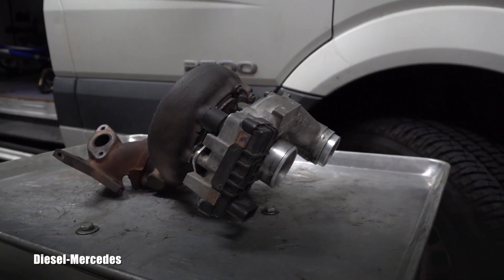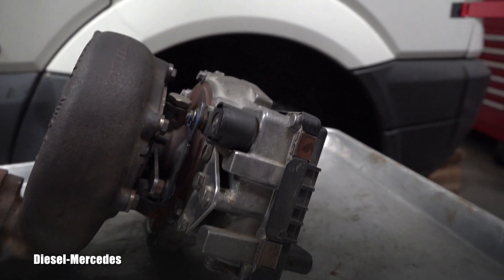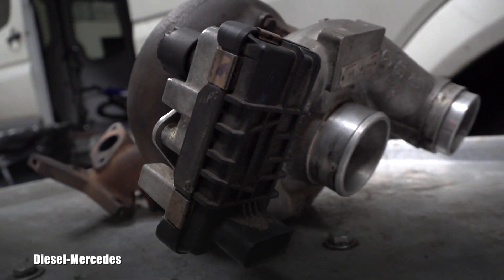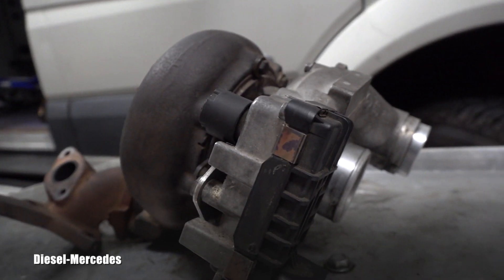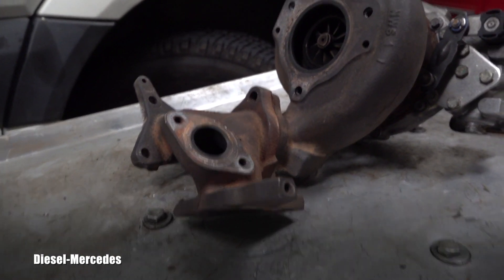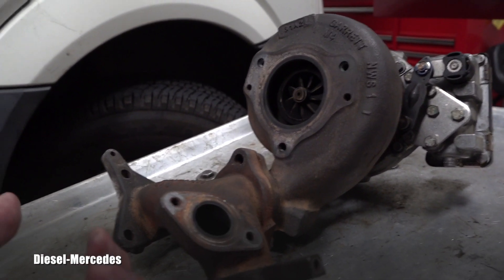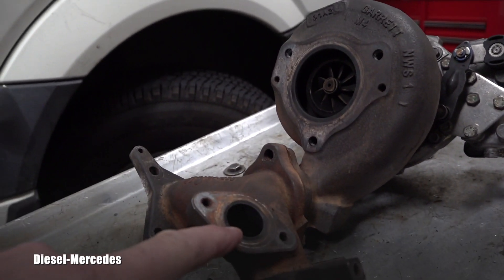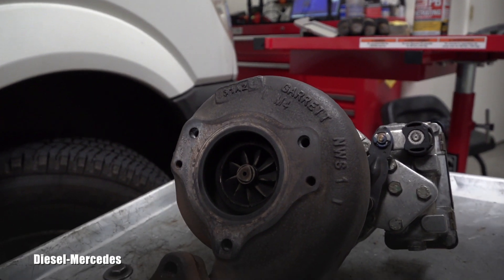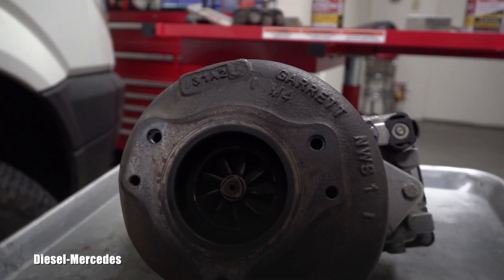I'll start with this angle. What you can see here is the electronic actuator from Hella — it's a Garrett GT20 turbocharger. The electronic part does the variable function with the vanes. This is how the gases enter: this will be the driver-side exhaust gases, passenger-side exhaust gases come from here. This is the EGR pipe which goes on the passenger side of the engine, and there is the whole EGR here.